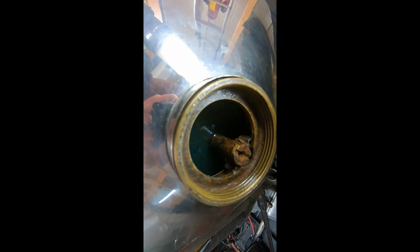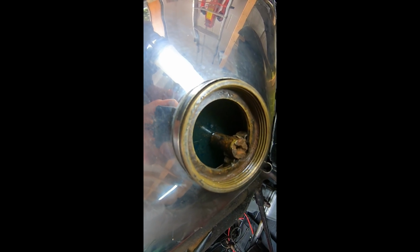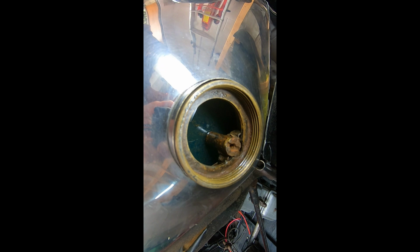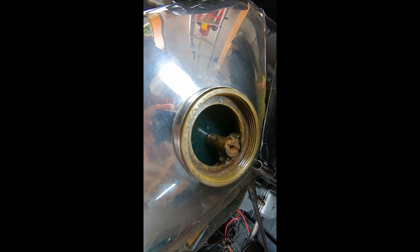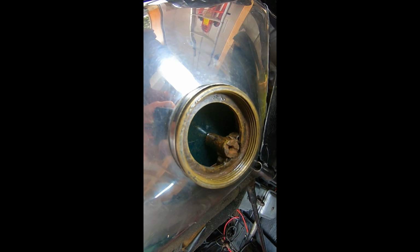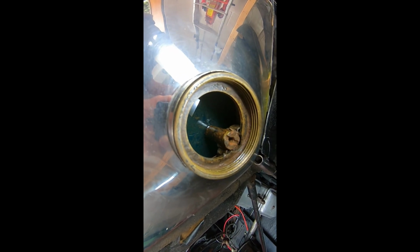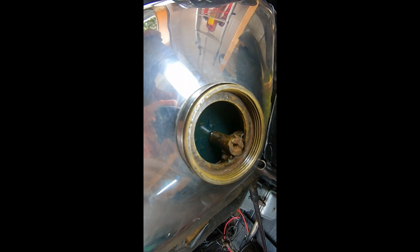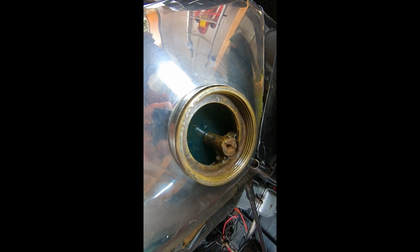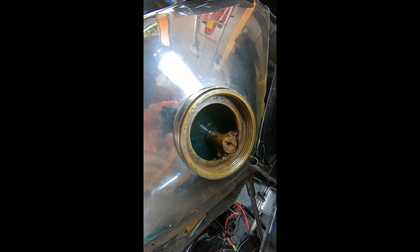And of course what happens is, as you're driving along, the water expands as it gets hot, and in some cases it will boil inside the engine block, and you get bubbles of air coming up the top radiator hose and bubbling up into this top header tank here, and bubbling up over the top and down the overflow pipe. This is normal. This is kind of about the right level, the normal running level. You can fill it up more.